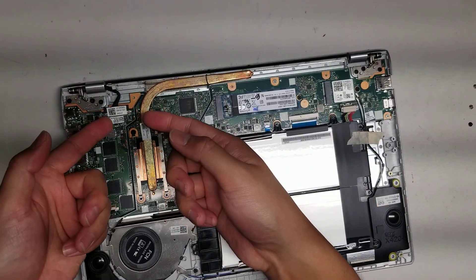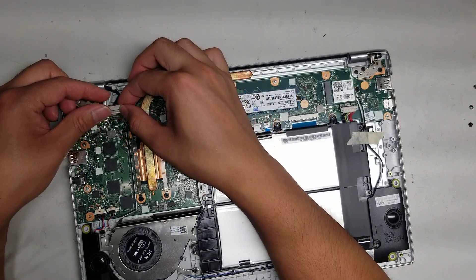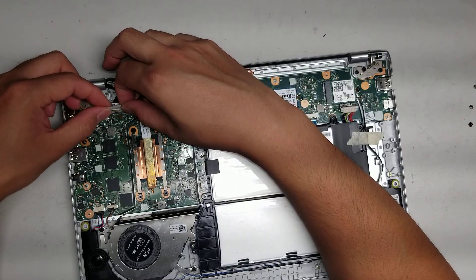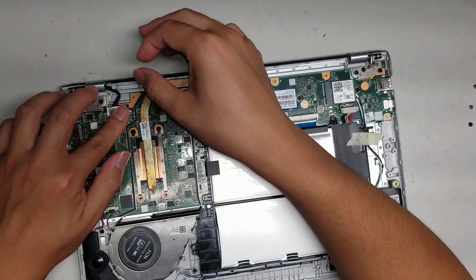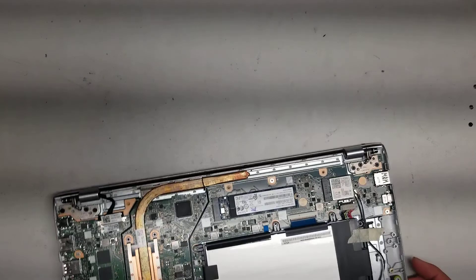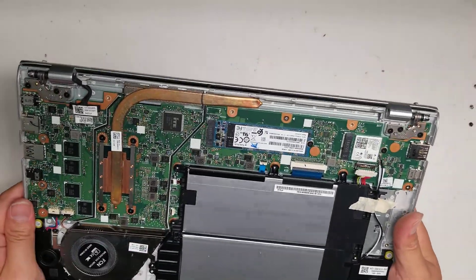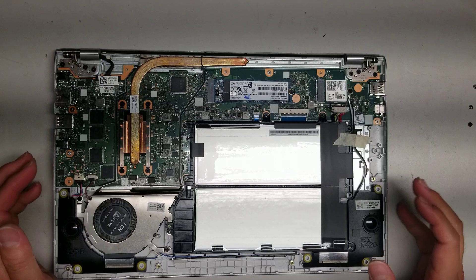I forgot to also mention the LCD connector here — they call it LVDS. The connector is a sliding connector, so you peel up this tape and then just pull the connector back to disconnect it. Make sure if you touch the LCD or LVDS connector that you did the battery drain thing — disconnect the battery and hold the power button down for about 15 seconds — because if you just yank this out, a lot of times people short out the backlight circuit. The charge port is also soldered in place, so a lot of this stuff you can't really repair yourself unless you know how to do these more advanced steps. Hopefully this video helped you — please like and subscribe, and thanks for watching.